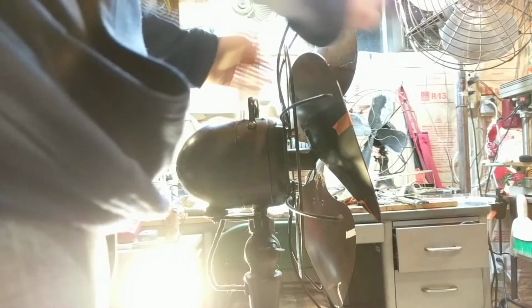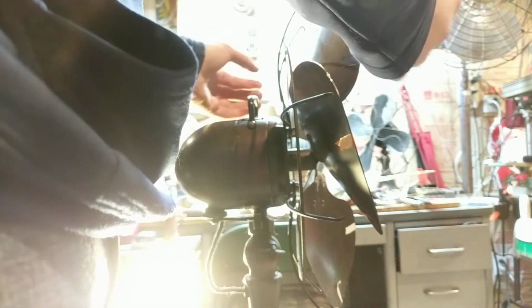If you see one of them pushed forward, find the blade like that. Usually you can put your finger in front and just find the one that's forward a lot. It's much easier with the guard on, but for the back pitch, you want to get this aligned first, and then you can start bending the blade, because if these aren't aligned, then it won't be balanced. Once you get those aligned, see how one's hitting? Let's see what's hitting. Obviously this one.